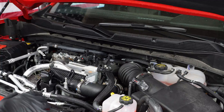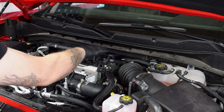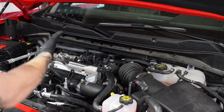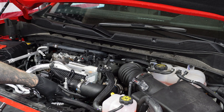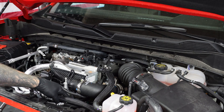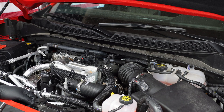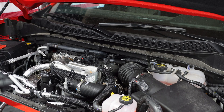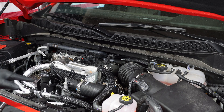Just set the bag over the air filter and put the air box lid back on — that's going to seal that off. So we've got it sealed on the air filter wall and we're going to inject smoke on the other end; the air won't be able to travel past. We're going to go with the port closest to the intake manifold, which is better because it'll fill the whole charger cooler system with smoke. That port is our intake air temperature 2 sensor, which we're just going to remove.